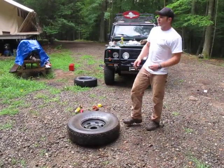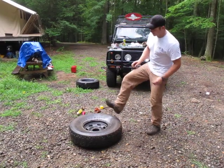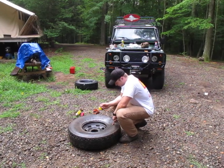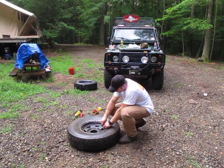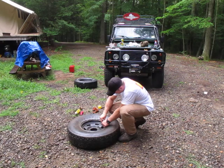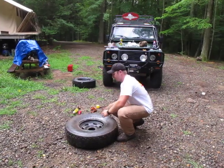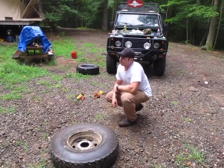I wouldn't kick the tire like that, but it tends to shoot out in different directions. So if you need to give it a kick, straight down up on top. Hear that air being drawn in? Once that stops, I'm going to go ahead and plug it. There you go, good to go. Always check the downside — bead set on both sides.